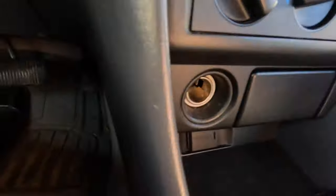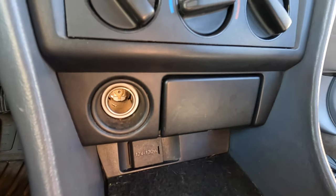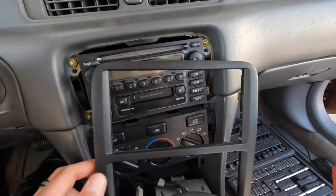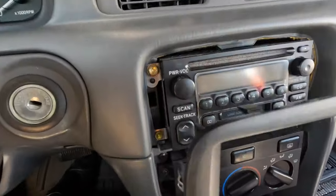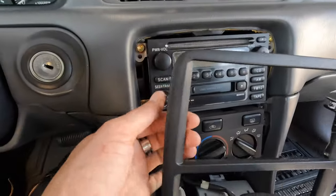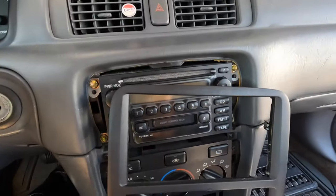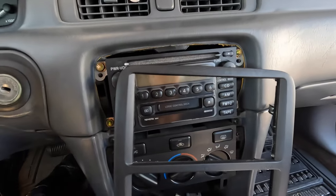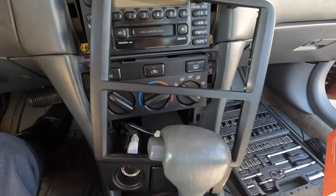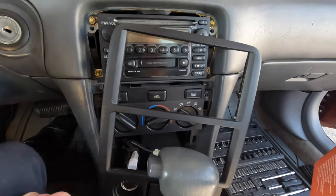Just pay attention — you've got a couple wires plugged into the outlets right here, but other than that it's pretty straightforward. It connects right here with these little push tabs. You can use a screwdriver but you risk tearing up the dash. To get it out of the way, you can unhook all this stuff — put the key in the ignition and pull the shifter back to help get it away.